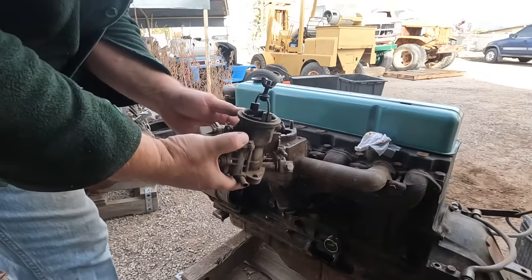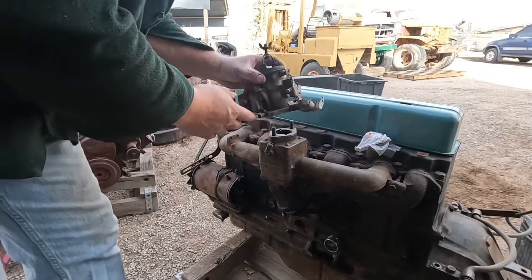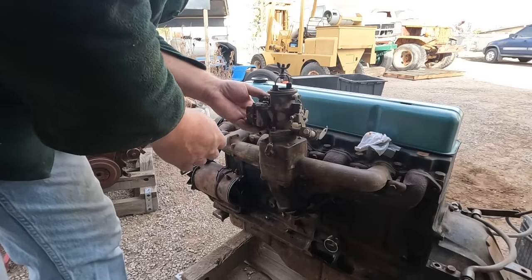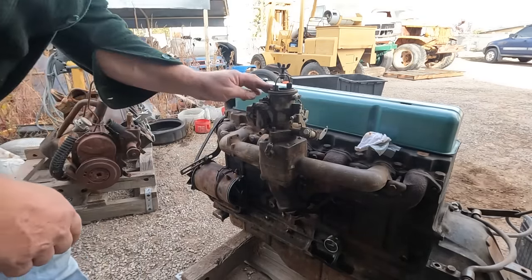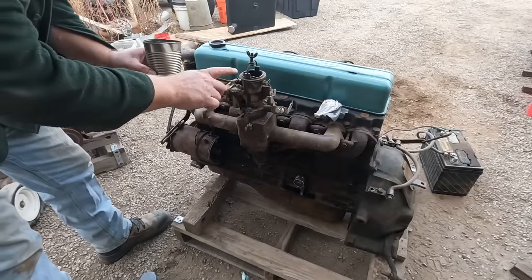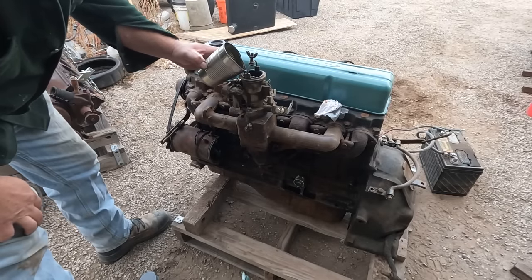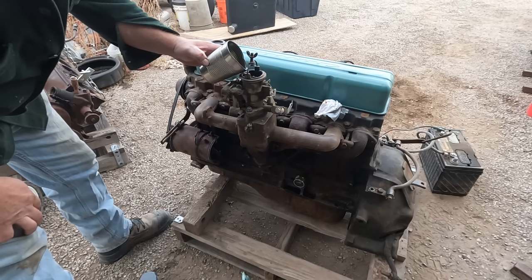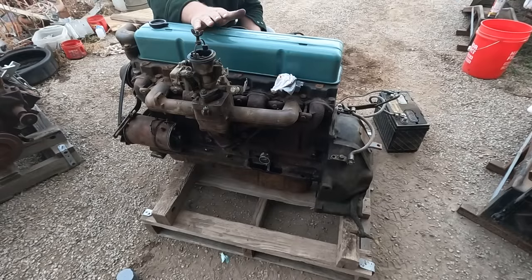I got a few carburetors here that could work. This is the one that was closest to me, so I'm gonna install it. And something like that. Probably need some nuts there. Might be a little bit of vacuum leak as is, because it's a bit wobbly. Now I'm gonna pour the gas somewhere in the general area of this opening in the carb. I'm actually gonna aim for the vent, the fuel bowl vent, but usually only about, let's say a third goes in there. The rest just pours right down it. That'll be fine. This isn't actually tied down, so I'm just going to put my hand here to steady the engine. Sure, that'll be fine.